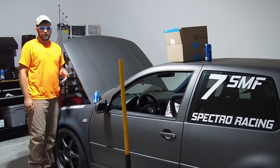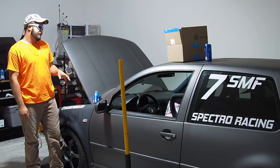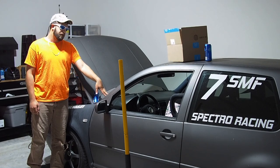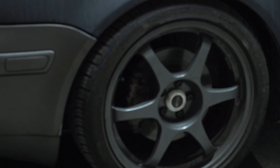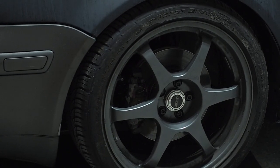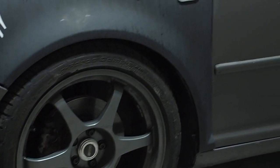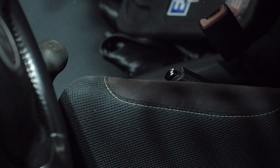So one of my monster-drinking, flat-brim hat-wearing, blueberry-vaping, hippie-communist acquaintances has kindly lent me this Volkswagen GTI, which I believe was personally a symbol of Adolf Hitler. The first major difference we're going to talk about is that these vehicles are front-wheel drive, presumably because they were assembled on the wrong side of the world. Since it's front-wheel drive, leaving it in gear when you jack up the front won't keep the car from rolling backwards, so make sure you set the handbrake extra tight and use a wheel chock for safety.